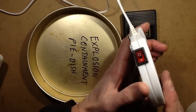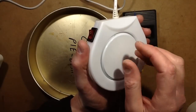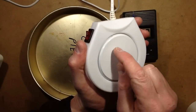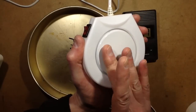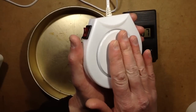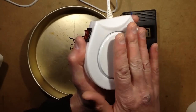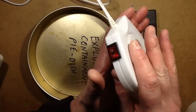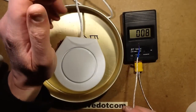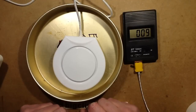Things to check when you get one: the routing of that cable inside is a bit shady, going underneath such a high temperature component. Also, someone mentioned they got a zap off one of these — I wonder if the sheet of insulation is missing in theirs, because that mica piece is quite important; it's what insulates you from the mains connection inside from this metal cover. The lacquer and paint will have some effect but not that much. It's an interesting device with possibilities for components, adaptation, or other applications, but I'm not convinced it's a great cup warmer — it's not going to have a huge effect.